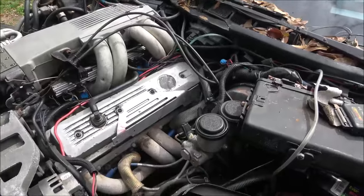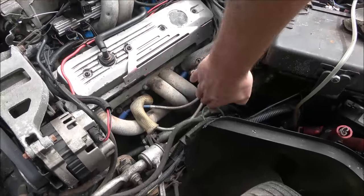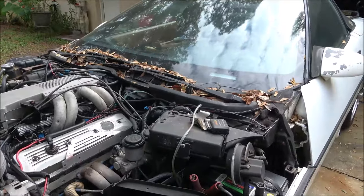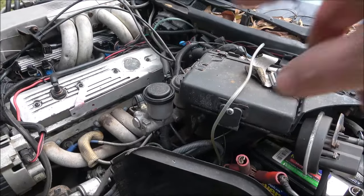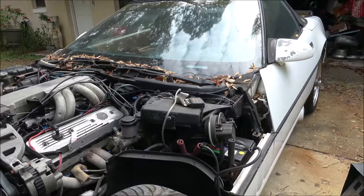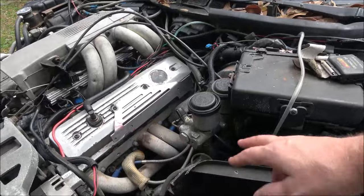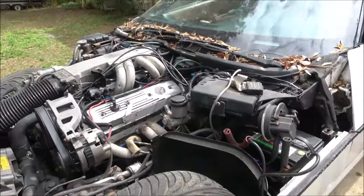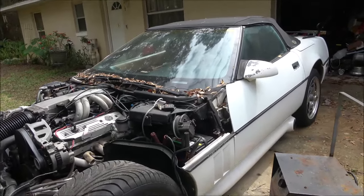That's called bypassing, and I think that's the problem we're having. I don't think it's stuck because the car moves. When we first brought it out, the brake pedal was stuck and I tapped on it - tap tap tap - and it released. I did that a couple times. That's probably not going to last long. I've got a used master cylinder ordered because the new one is over two hundred dollars. I'll run the used one while I go ahead and rebuild this one.